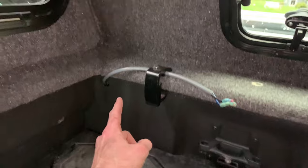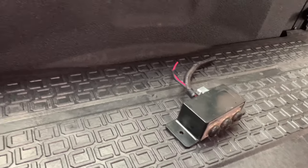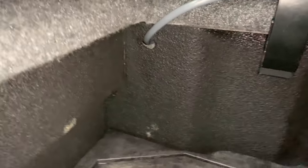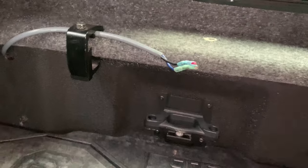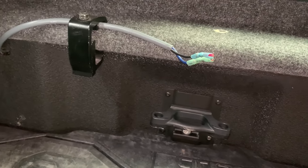I've got my new wire coming up here. I'm going to re-splice this end — I'll do that before the end so somebody can complain I did it hot. Well, how do you know I didn't have a fuse out? Anyway, all I did is stick this fish tape down that hole, because I don't have long enough arms to reach up and stick through that hole, plus there's a bracket in the way. So I just stuck that fish tape down, taped it, and pulled it up through. Now I'm going to splice this and then run the wire up to the battery.